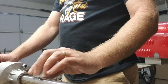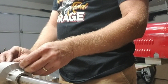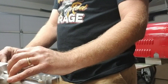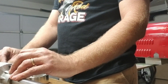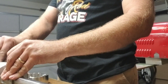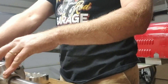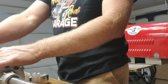The differential from Peerless comes with these through bolts. We're going to take these out and use the Vintage Cartco supplied bolts. The stock bolts are what would normally just hold your sprocket on, but because we're using a sprocket and brace combo, this spacer requires a different, longer set of bolts. This is a threaded housing, so these bolts thread into here and they come to you really tight — I had to put it in the vise to knock this thing loose. We'll replace them with the longer Grade 8 bolts that Vintage Cartco gives you with their spacer kit.